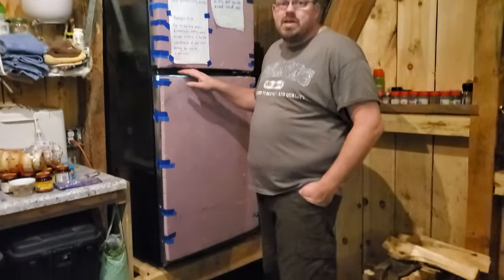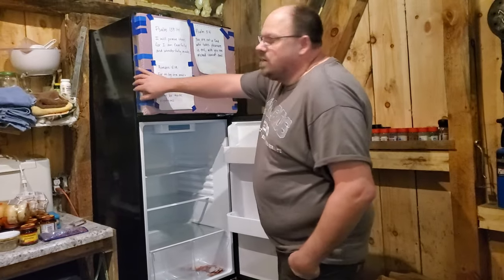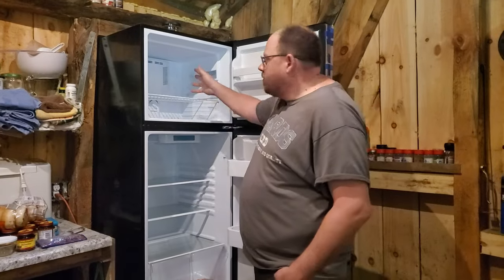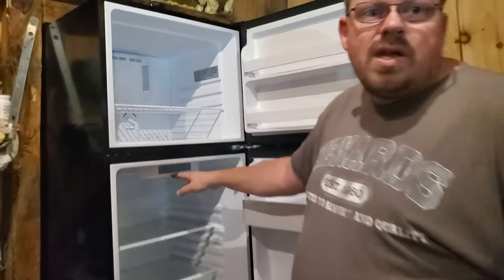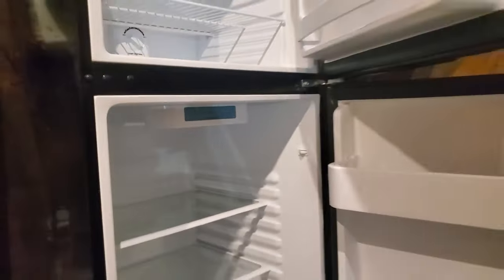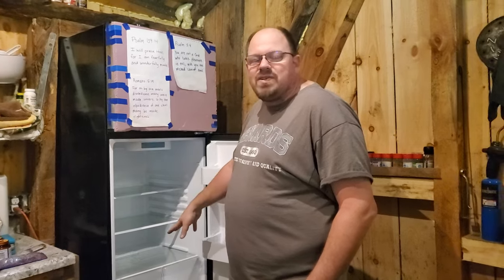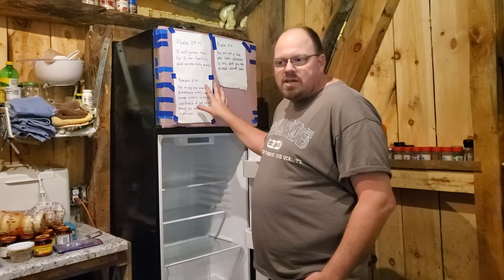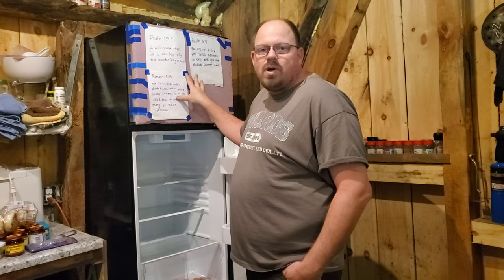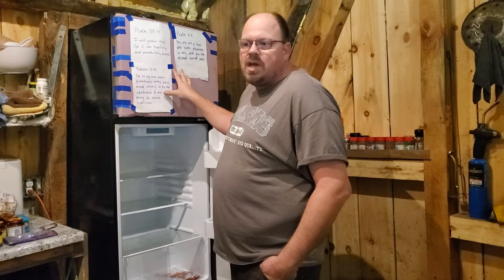So we put the fridge up here — we raised it because it's much easier to get into at this height. I can see what's on the bottom, and patients can still just barely get into the freezer. Another issue with these freezers is the temperature control isn't independent — to make the freezer colder you have to make the fridge colder and vice versa. We ran into issues with that: when the cabin got down around freezing temperatures, stuff in the freezer would thaw and stuff in the fridge would freeze. Weird things were happening when we had to leave the cabin, so this fridge was not working for us off-grid when we're heating with wood and need to leave the cabin.